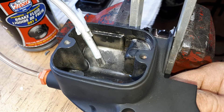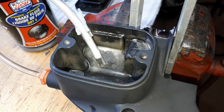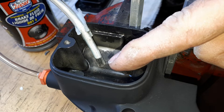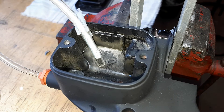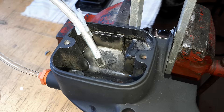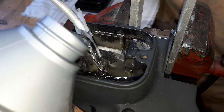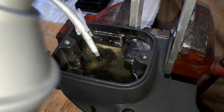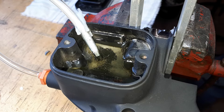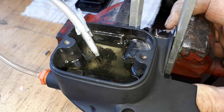I'm going to activate the piston right here with my thumb and basically keep going nice and gentle, cycling back and forth until I have no bubbles coming out of the bottom of my tube. Simple process — only takes a few minutes with a small master like this, but if you neglect this step you're going to have a problem. Always take your brake fluid from a sealed container because it does absorb moisture, and just pour in about halfway. Don't shake your brake fluid either — you're introducing air into the system. So I'm just going to gently push it in.